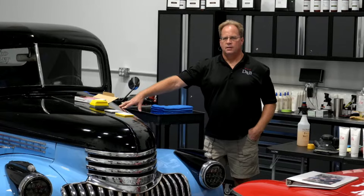Okay, so, whenever you hear the term sanding, it should be done on custom paint, not factory finishes. I bring this up because I know there's a lot of confusion about it. A lot of times someone buys a brand new Corvette, looks at the orange peel, and wants to know if some professional detailer can fix it. Even if you can find a professional that's confident to go in, sand that paint job flat, and buff it out without burning through anywhere, he's going to have left that clear coat so thin that it's going to suffer clear coat failure down the road. So it's really not a service to you. Sanding should be done with custom paint only.